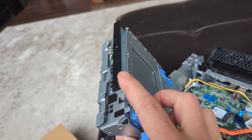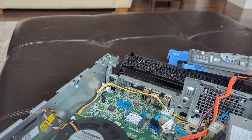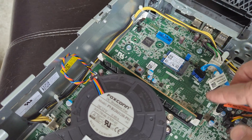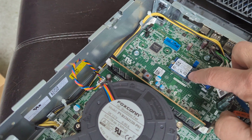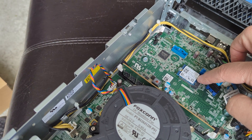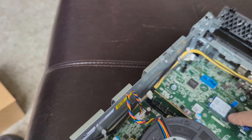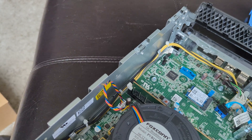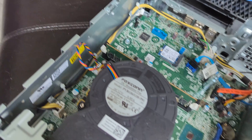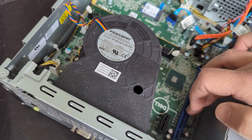Here again is the memory, which allows two chips. If you see a short little piece in a slot like this, that's likely your Wi-Fi or Bluetooth card — it acts as an antenna for your connection. Usually these are Bluetooth; Wi-Fi could be built in or a separate card. There's also an expansion port here where you can add an additional card for higher performance.